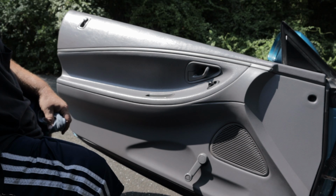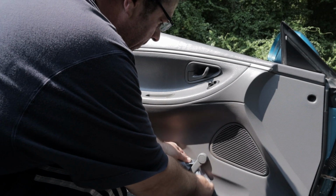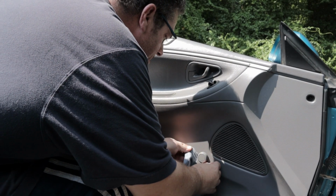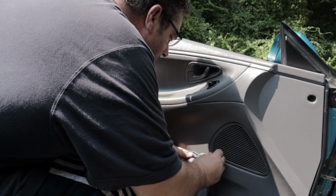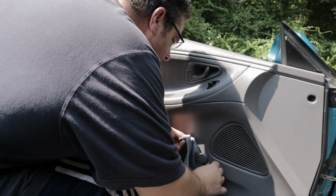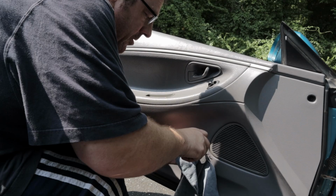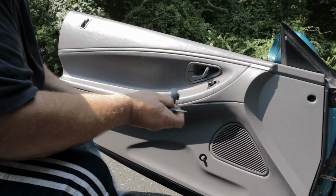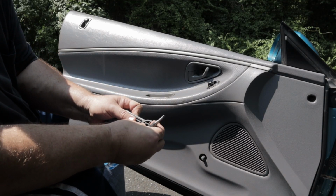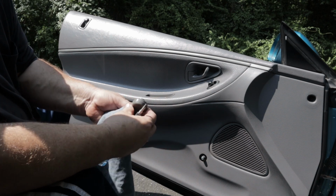And I still have the old wind up, roll your windows up knob. There's a trick to get that off. I always get like a rag or something. And you gotta kind of slide it, and there's like a little spring in here you gotta catch, a little spring nut thing. There you go. Popped up a little bit. Get the screwdriver. There's your knob. See, it's a little spring. Catches in right back here. Once it's engaged, it's slid down. I'm just going to pop it down now. So that's engaged. You use like a rag or something and push it up, pops it out. So put that aside.